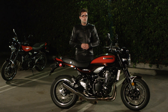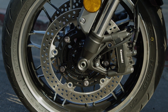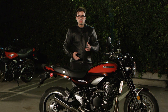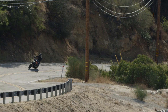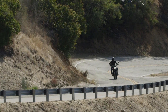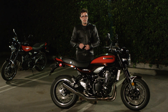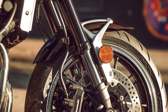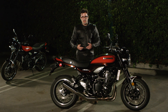Moving on to the brakes, they did update to four-pot radial calipers for the Z900RS versus the Z900. The brakes have great feel at the lever — pretty progressive, not overly vicious with a bite. It's totally adequate for the weight of this bike, which is hovering around 470 pounds, and keep in mind this thing can really get up and go. If I were to add this to the garage, I'd definitely upgrade from the rubber lines to stainless steel and get a more high-performance pad, because I feel like there's still a little bit more in those braking components — a little more attack. But that's just my personal preference.